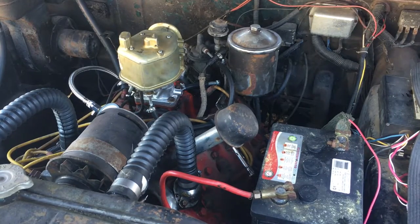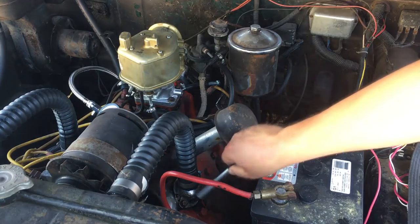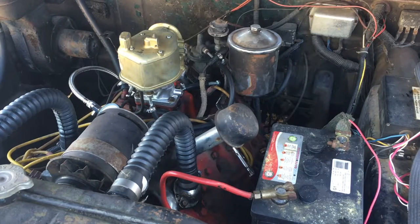I see a lot of old leaks and stuff around some of these spark plug holes. They look to be pretty old with some of the paint flaking off, so it looks like this car's had some leaks at some point. I do still have a leaking water neck here, so I'm going to pick up two new ones of those — that'll stop it from seeping.